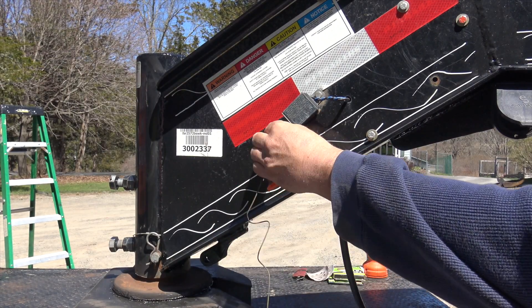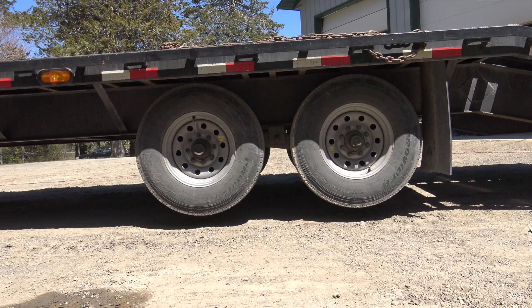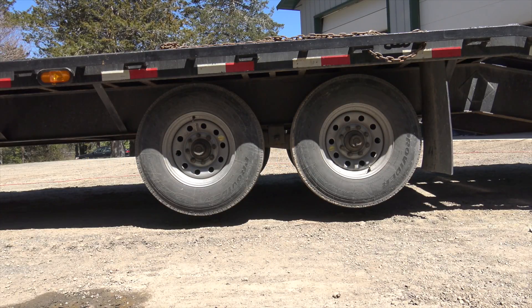In this situation you don't quite hear the brakes actuate - you don't hear that humming sound. What you'll hear is when Raymond plugs the trailer brakes back in, you'll hear a loud clicking sound, showing that the brakes released. Raymond will pull the pin, a couple of seconds after I say brake we'll let the brakes engage, then check for our audio test. Brake. We don't hear anything - before we heard an audible buzz. When Ray puts the plug back in we should hear the brakes release. Plug in. I didn't hear anything.